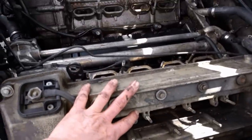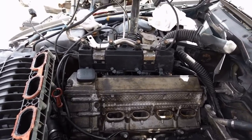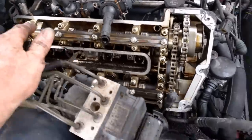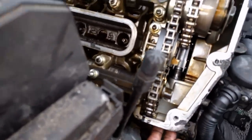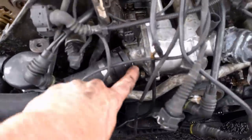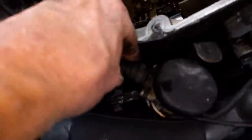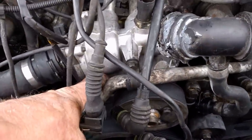We're going to take this valve cover off and then flip it back over and take the other valve cover off. We have to take both of them off for the timing. With the fuel rail flipped back over and this valve side cover off, the next thing is there's a chain tensioner with one bolt that goes up underneath here - go ahead and take that out while we can still get to it. We also have to take the water pump off. You have a crossover tube here with one bolt on this side of the head and another bolt by your pollution fitting - take those three bolts out and this crossover tube will come out. Wiggle it out easy, don't bend it.